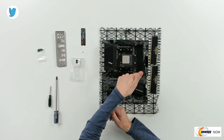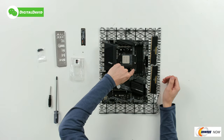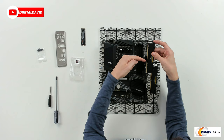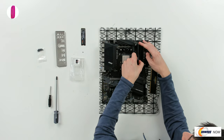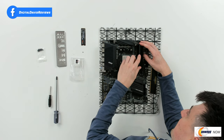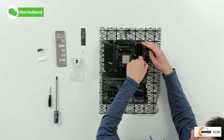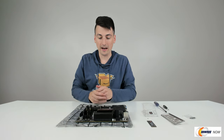Now let's go ahead and work on the sticks of RAM. So you'll get familiar with your board. The user guide manual will tell you which slots to use depending on how many sticks you're using. In this case, we actually had the layout right here printed on the board for us. So we'll be using the DIMM A2 and DIMM B2 slots. Now we just take our RAM — you can see they're different sides — so we have to make sure that the longer side is where it needs to be. Just line it up and gently drop it in place. You shouldn't have to force anything, and then it will make a nice click for you. We just got the first stick installed. Same thing with the second one — pay attention to how it's going to go. It's only going to fit one way, so you don't want to force it. Gently press in and you can see it just clicked in. The RAM has successfully been installed.